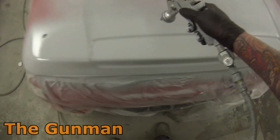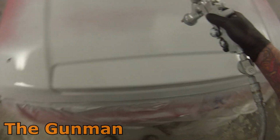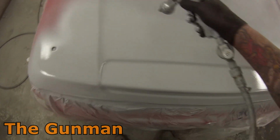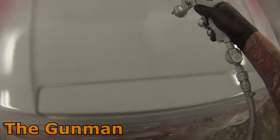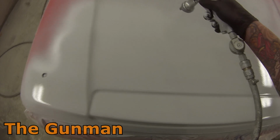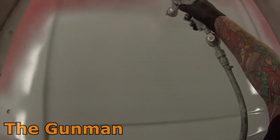But then you go down the other end of the spectrum, you go real dark primers and black primers and coloured primers. I've found that when you start sanding them, they'll clog the sandpaper up really quickly. There's probably something to do with the extra pigment in the primer that just makes it tricky to sand. It's sort of nearly like sanding clear. It's not that bad, but it's nearly like that.